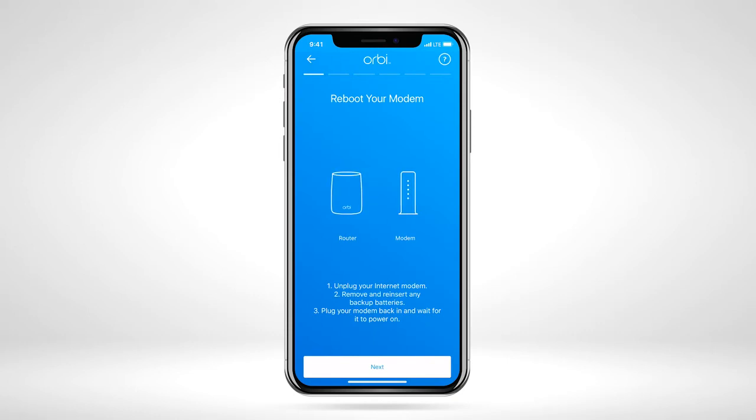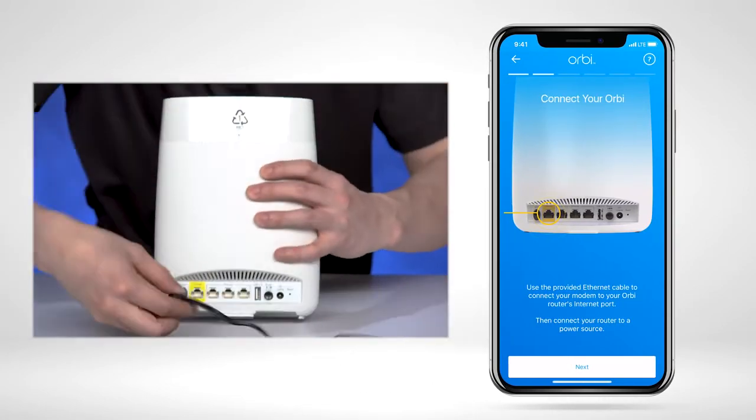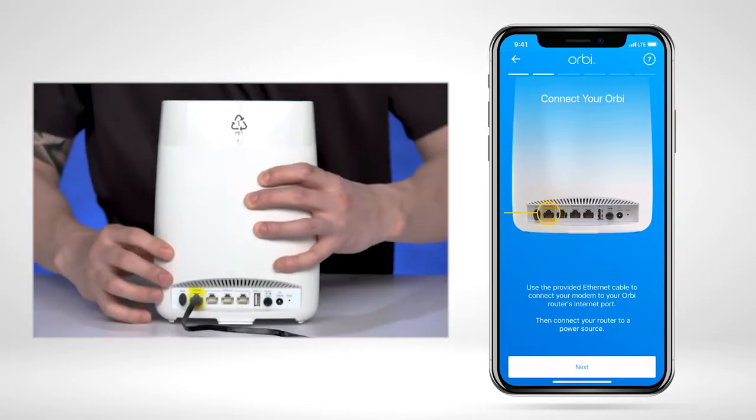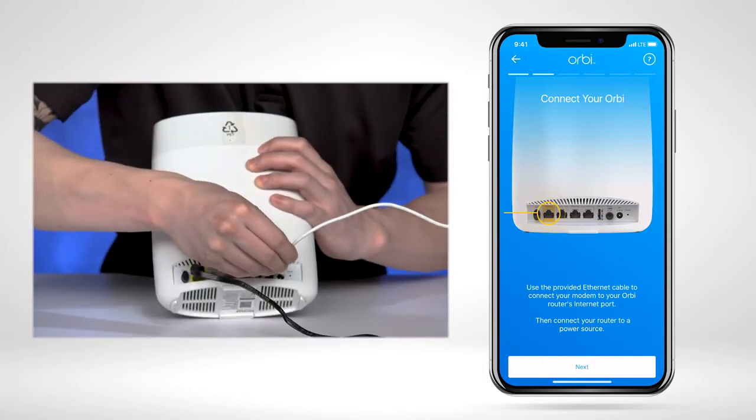We recommend rebooting your modem when upgrading to your new Orbi system. Then, plug the Ethernet cord into the yellow Internet port on the back of the Orbi router and plug in the power adapter to turn it on.